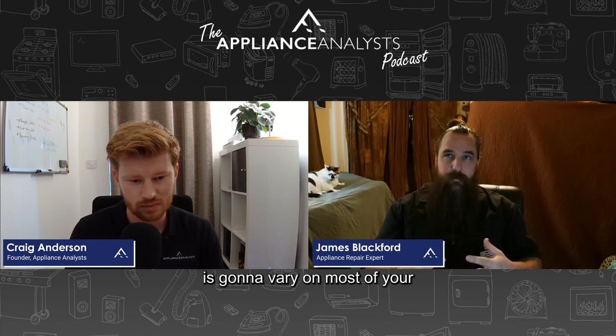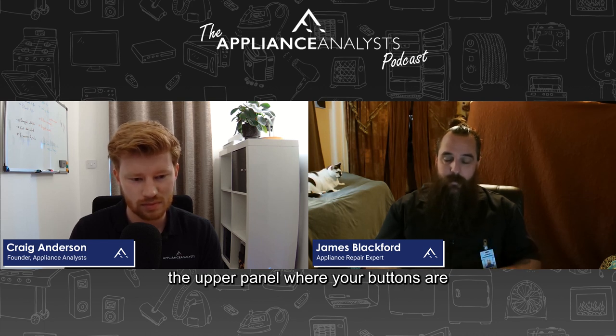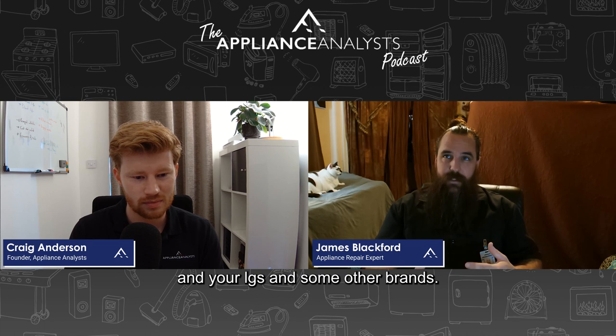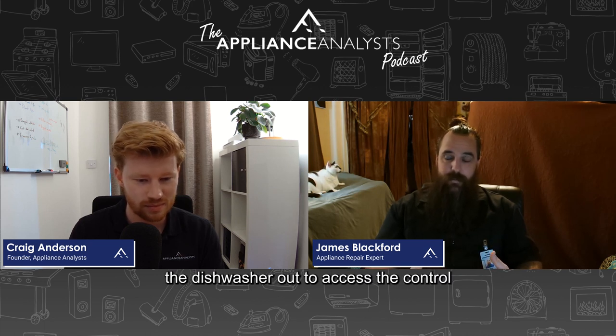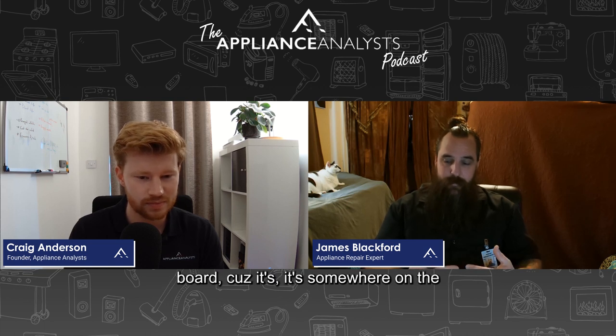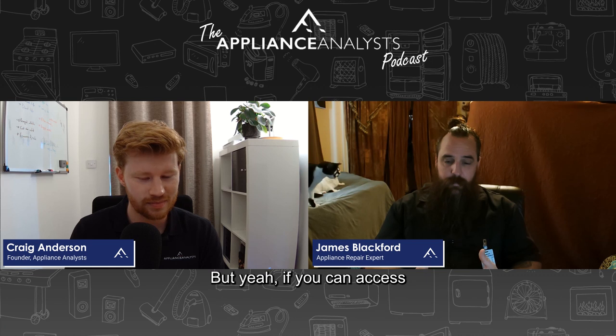On most of your domestic dishwashers, your Kenmore, Whirlpool, Maytag, that control board is typically in the upper panel where your buttons are. In your LGs and some other brands, sometimes you actually do have to pull the dishwasher out to access the control board, because it's somewhere on the bottom, mounted usually on the right side. But if you can access it, that's going to be the issue.